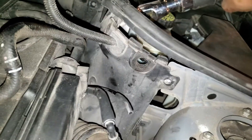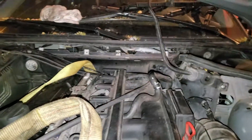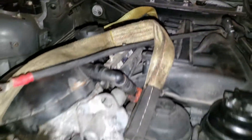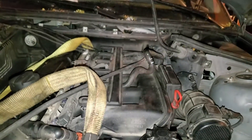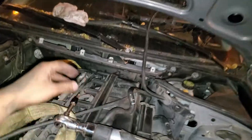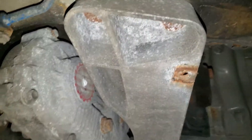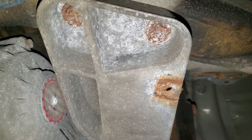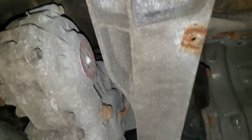There's a T30 bolt right there and a T30 bolt right there - I'm gonna take those two out so I can get that back plate off and reach my hand in to put the rope on that mount. There's one on the back but it's really low, so that plate just slides off like the cabin air filter - I can actually reach my hand back in there to get that rope on. Now I need to get those transmission bracket bolts - they're 13 mil and pretty rusty.